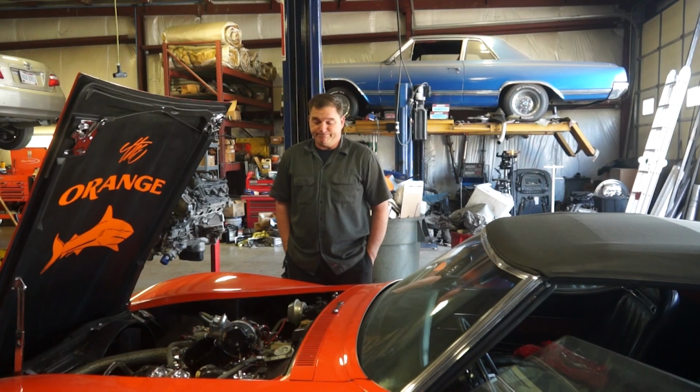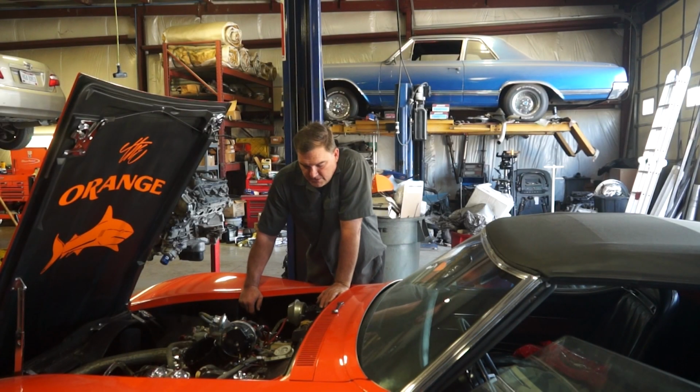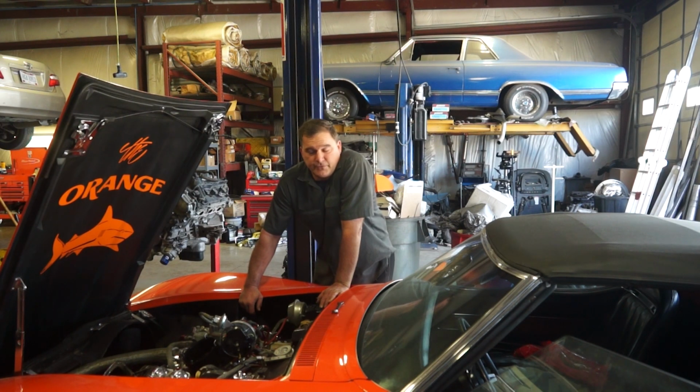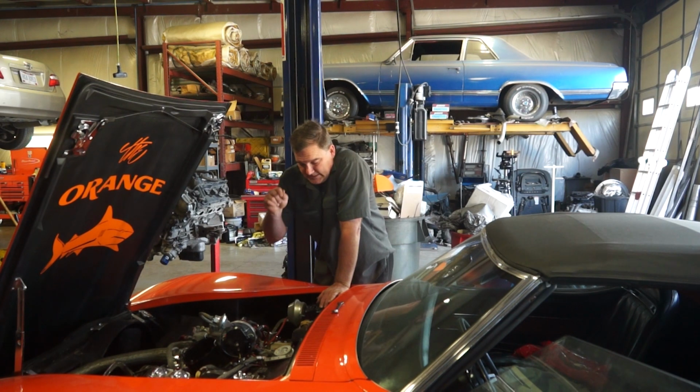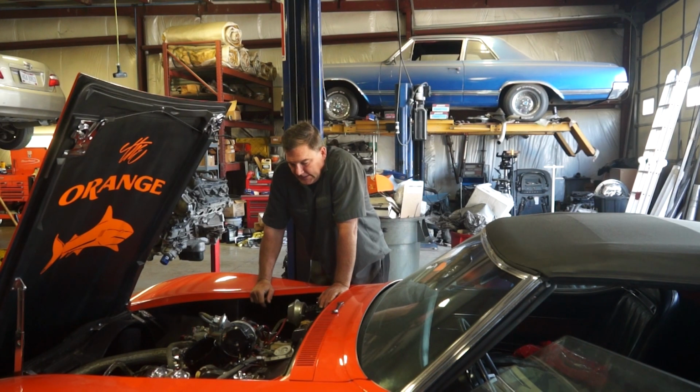We're going to start with the Helicoil repair. I have to drill that, and it's right next to a big opening where the distributor goes down into the engine. So I'm going to grab some rags and I'm going to pack the hole full, so no aluminum shavings go down the hole. Then I'm going to drill that hole oversized. I usually just step up from the largest drill that fits through the threads, and then I just step up one drill bit at a time. It allows me to keep my hole straight and true. And then we'll go from there.